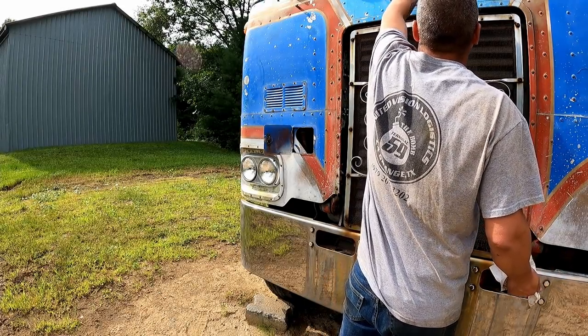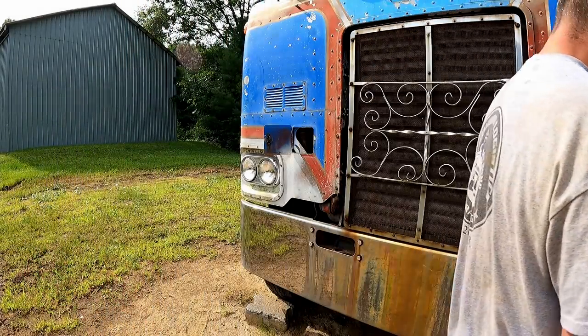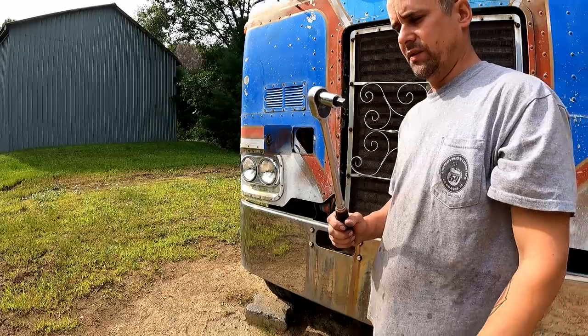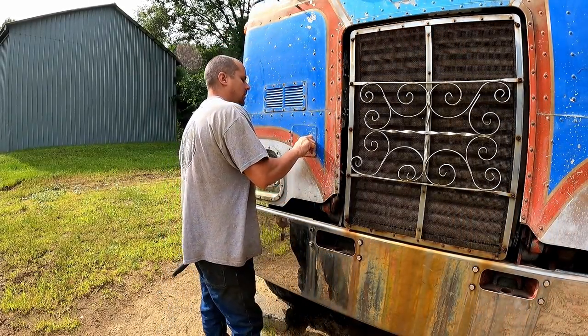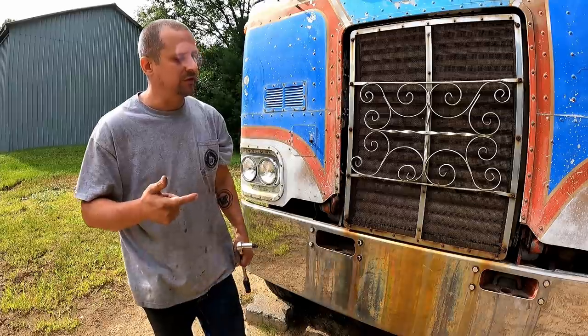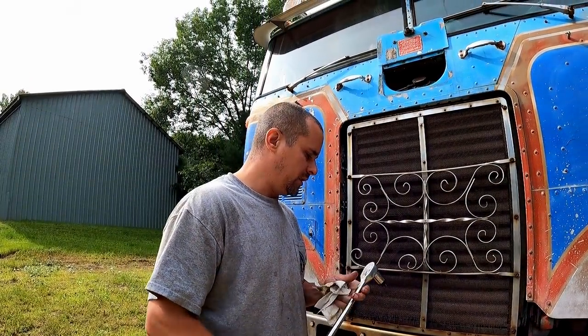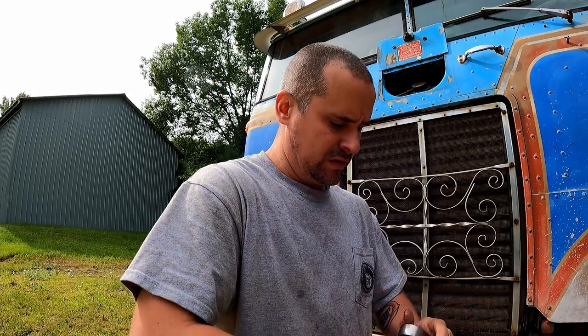So, what I'm going to do off camera is I got my ratchet, and I'm just going to crack the drain plug and make sure there's nothing crazy going on. Because I would hate like hell to come this far and then knock the bearings out of this thing. So we're just gonna do that quick and then I'll bring it back. Perfect. Freaking oily. Happy report. Nothing but oil on the dipstick or on the drain plug coming out. So ready to fire this old girl up again.